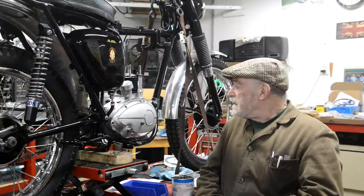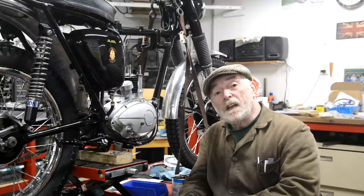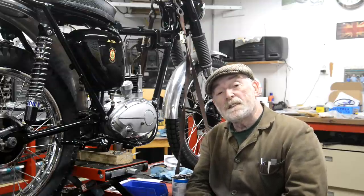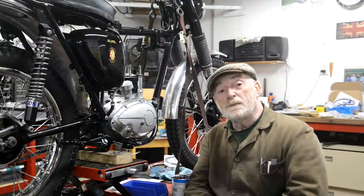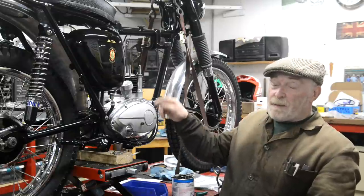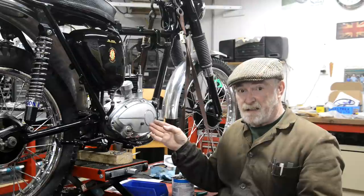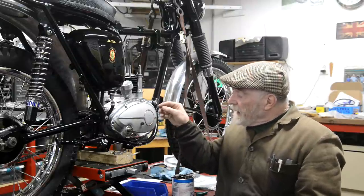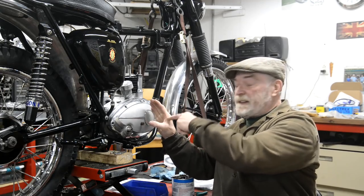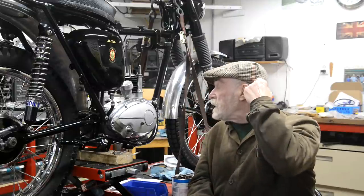Right, well, had a lot of comments, and as I expected, I got a bunch of hints and tips from the C15 people, so thank you very much for them. Little things like when I was putting that split pin in, which, don't worry, the split pin was fine. If you put it in, I think it's fourth gear, the hole is pointing out, it's easier to get the pin in and then you can slip it through. And so anyway, lots of stuff like that. So there's a couple of things.